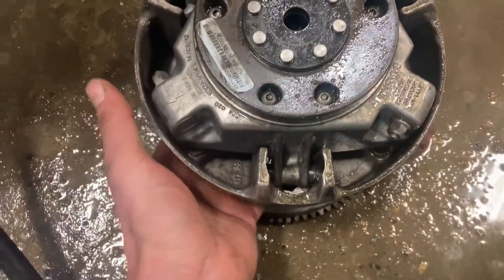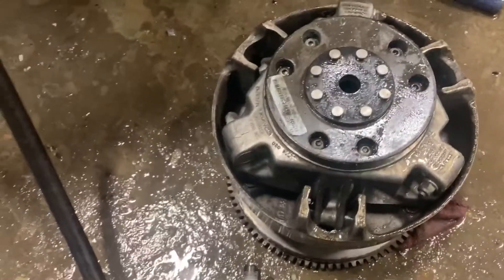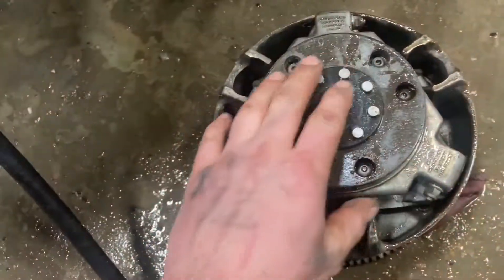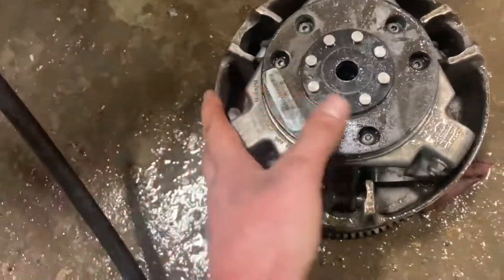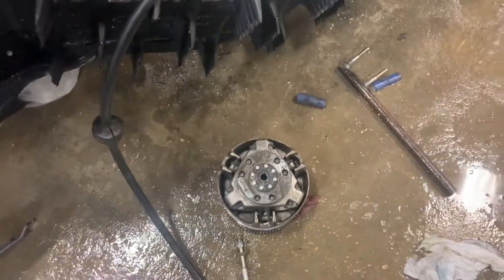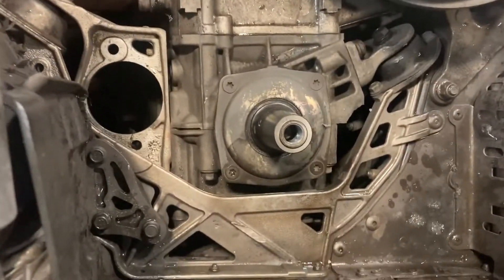I don't think there's anything wrong with warming it up — don't get it red or anything, but you can put some heat to it to get it off. I know it's a mess. There's gear oil in here — I'm going to clean it all out. I've already blown these clutches out and stuff, but my goodness, that was ignorant. I'm going to get this bearing apart now and see what's in there.